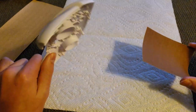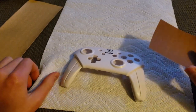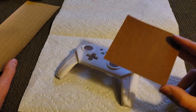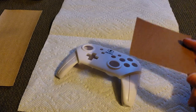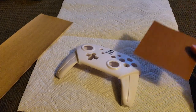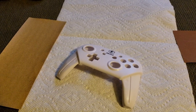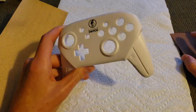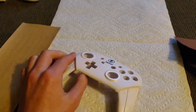For sanding, always do it outside or on a surface that's easy to clean. When sanding plastic, use a high grit level sandpaper — that means it'll be finer. I have 140 grit and 150 grit. Start with the lower one — so I start with 140 — and then go up to 150 to finish it off. Also try not to breathe in the dust because it's bad for you. I'm going to try to sand off the Switch logo on the shell because it's pretty ugly — hopefully it comes off easily.